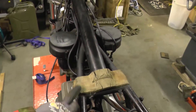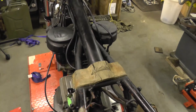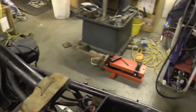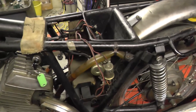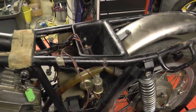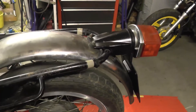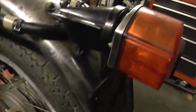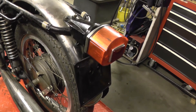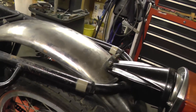Another thing you don't see very often is the original rubber tank pad, which is wired on. It's really crusty and smelly — the rubber's degraded — though it's in better condition than almost any I've seen before. There's an indicator relay and a buzzer with some speaker wire associated with hooking that up. It's an early enough machine that there are no lugs on the frame for indicators; they did a fitting kit that picked up on the bolts on the rear plate mounting.